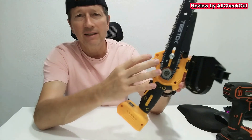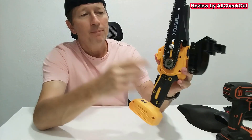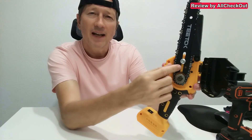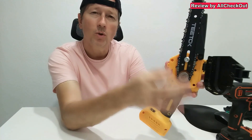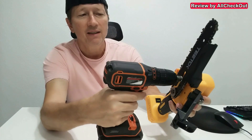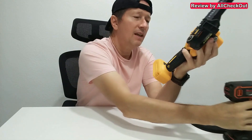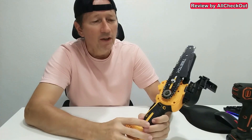So you are not at risk that the whole thing will fall out. And because it has a spring to tighten the chain, as soon as you untighten the screw it's automatically tightening the chain — you can see really, really nice here: no gap, not too tight, not too loose. You can just untighten it and tighten it again and the thing is done, no risk that everything will fall out.